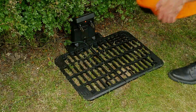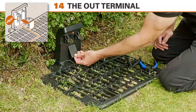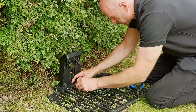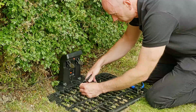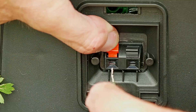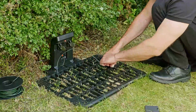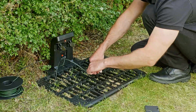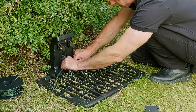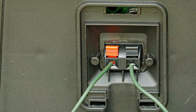Remove the Landroid from the docking station. If you're happy that the perimeter wire is accurately laid, remove the terminal cover on the base station to connect the wires. Start with the outgoing wire — cut the excess cable, strip the end (about 0.4 of an inch is enough), and insert it into the red left clamp, which is the out clamp. Now guide the other end of the cable through the guide channel on the right side in the same way as before, then cut the wire, strip it, and connect it to the black terminal on the right. Close the cover.